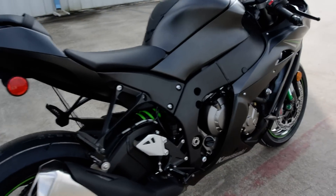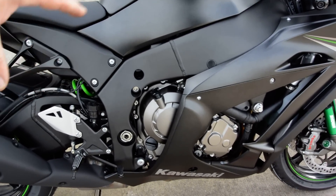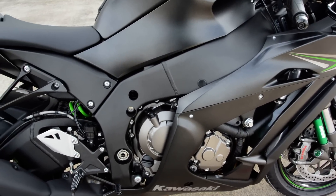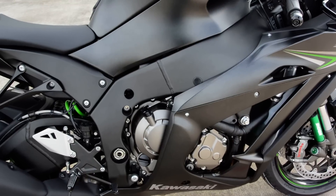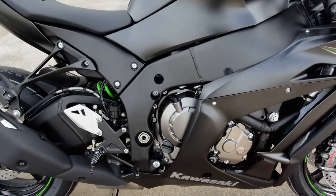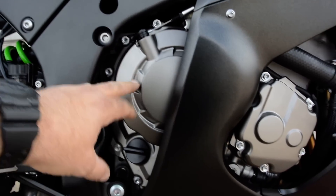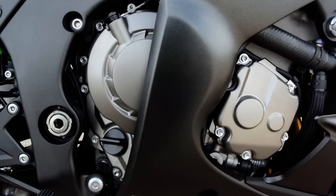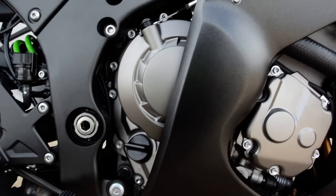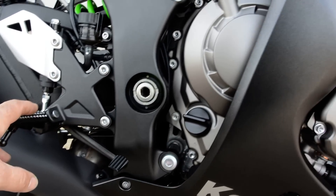These also have a cassette-type transmission. If you heard about the Yamaha R1M recall where they're having to completely tear down the motors, remove the motor from the frame, and split the cases — that's not great. But on the Kawasaki, with a cassette-type transmission, you remove the clutch cover and clutch, and there's a plate back there with some bolts, and the transmission pulls right out the side of the motor. Very easy to perform gear changes for different tracks when racing, and much easier for repairs. I really love that cassette transmission.